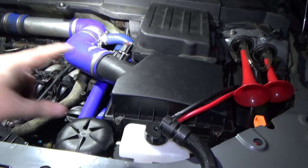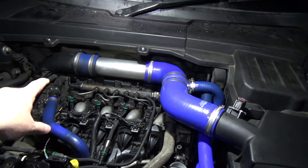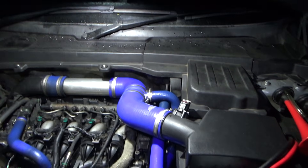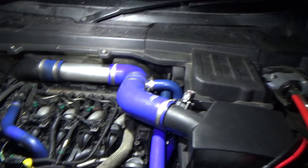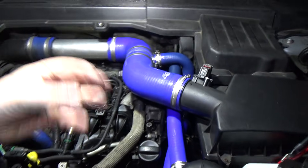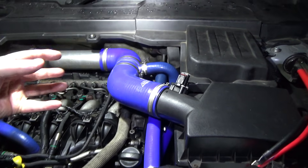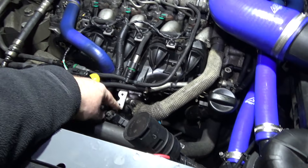That return hose goes across the back of the engine through the EGR — the exhaust gas recirculation. That is a valve that at certain times allows exhaust gases to flow up, get cooled by the coolant because they'll be red hot, flow through the EGR, get cooled by the water coming back from the heater, and then come down this pipe and into the throttle body.